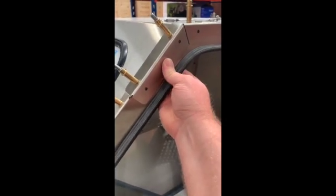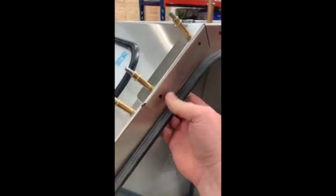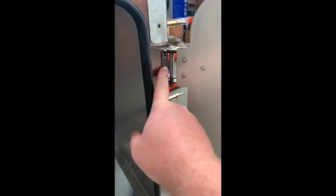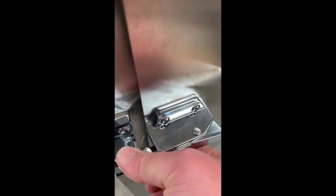That's pretty much the assembly of the cabinet. It looks daunting when you get it because you get a great big crate full of what looks like 101 items, but it's actually fairly straightforward. Fit the side panel first, fit the corner pieces, make sure the metal is nice and tight together before using the pop rivets so you don't end up with gaps. Fit the door seal — it will seem too long but it isn't, just force it into place and it will fit. Hang the hinges at the back first onto the cabinet, pop the bolts in, pop rivet the bottom one on, close the door, lift it up a touch higher — another couple of millimetres — then pop rivet the top hinge in, and it should hang in the perfect position.